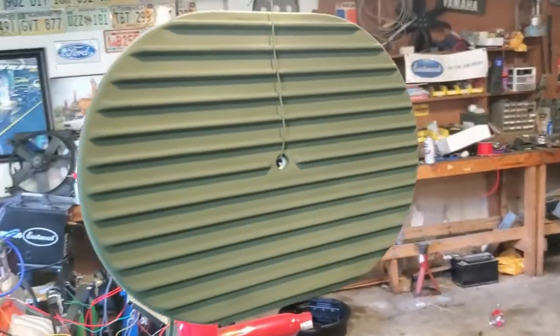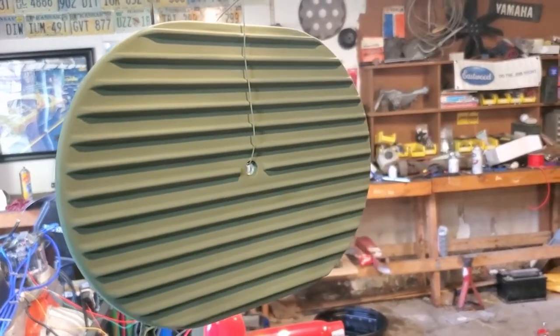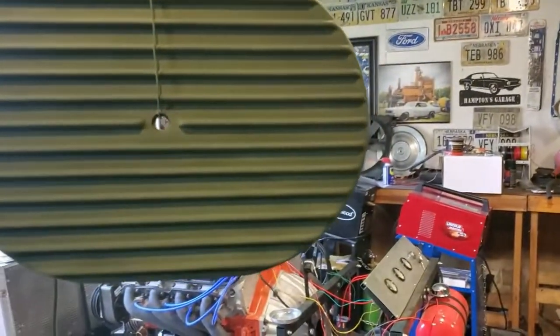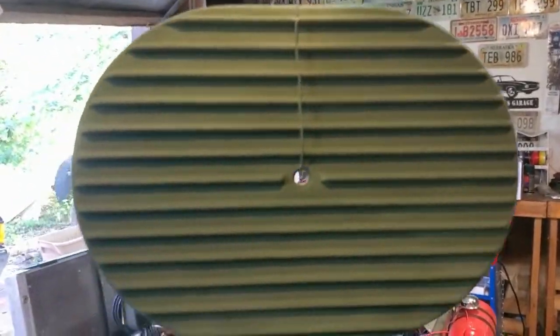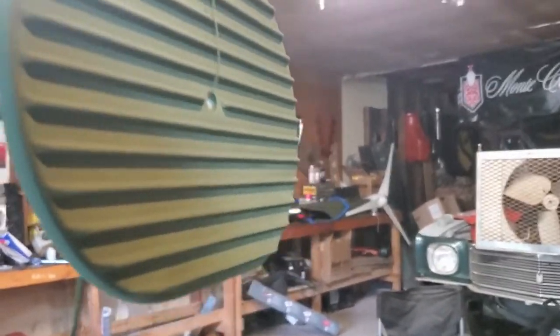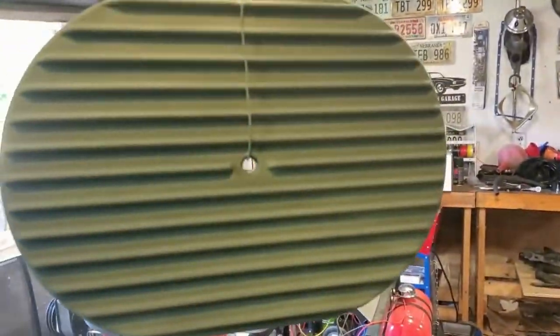We got the second coat going. It's baking right now. It's kind of hard to see if there's a reflection in. And we applied a little bit of heat, and that seemed to help with getting our powder applied. Then we turned down the pressure. We had the pressure kind of way too up. I forgot about regulating the pressure. It needs to be about 7 to 10 psi. So this one coated really well.